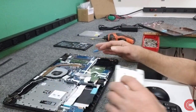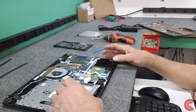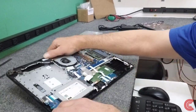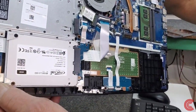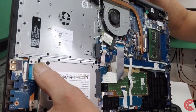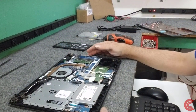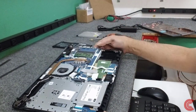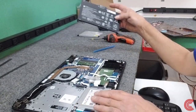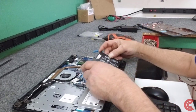So now we're going to carefully set it in. Make sure the little IO board didn't come loose — we're going to plug it back in, make sure it goes in all the way, and set it down. There are two little plastic tabs right here that it goes on. We won't be adding more RAM, just the solid state drive. So now we're going to carefully set the battery — make sure everything's good — and set the battery back in here.